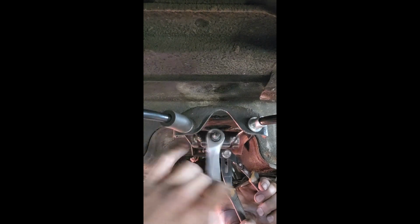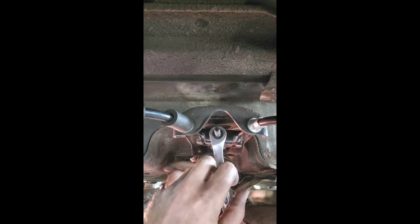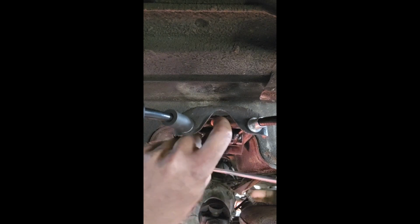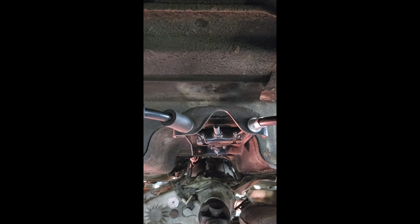So I'm going to get it till it's just a little snug. Everything's still all loose, so I'm going to go a little bit tighter. Super tight, but pretty tight. Before, I had this nut on my old one all the way to the absolute end, and it was still loose. So right now, I'll just go give my e-brake a little pull and see how firm it is. You know, if it's three or four clicks and it starts to get stiff, I think that'll call that good.